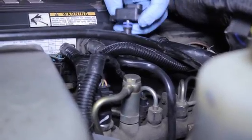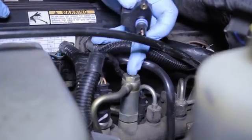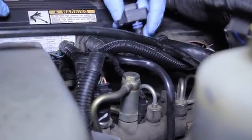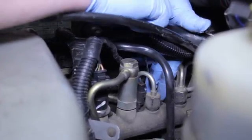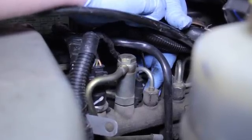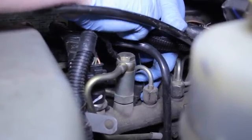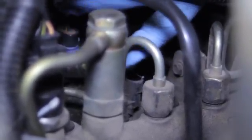The sensor is located on the intake manifold, kind of behind the air inlet, and we can see the fuel piping coming in here. First thing I'm going to do is take my little pick and get around the back side of it to the electrical connector and disconnect that first. This is two screws to remove to get this off of there.